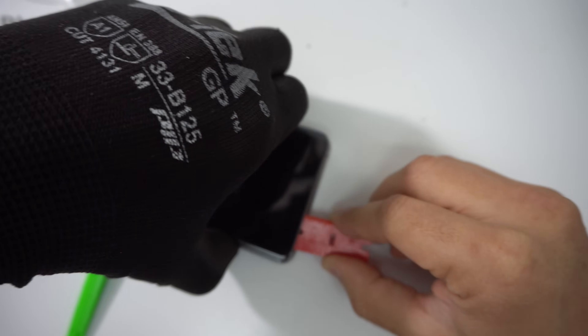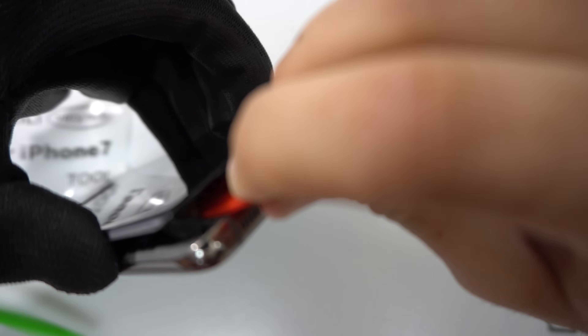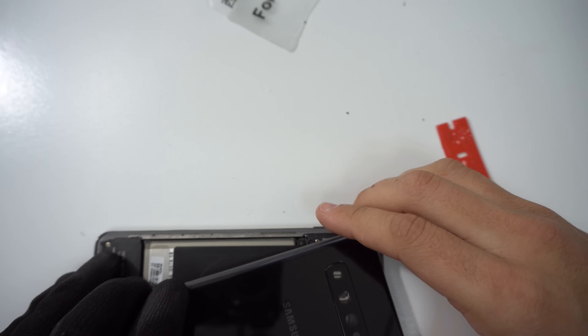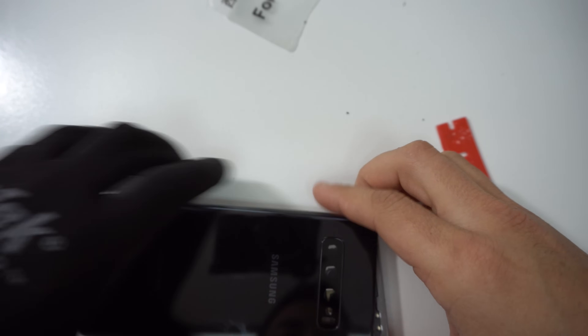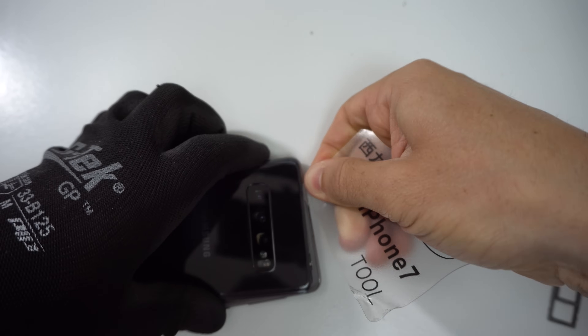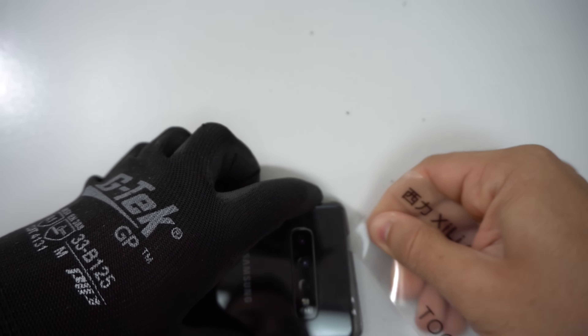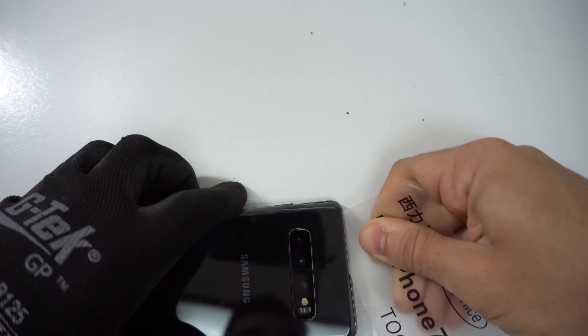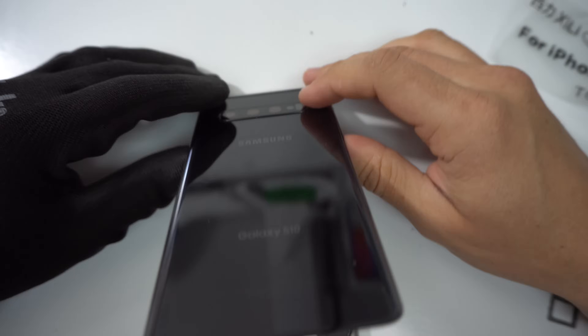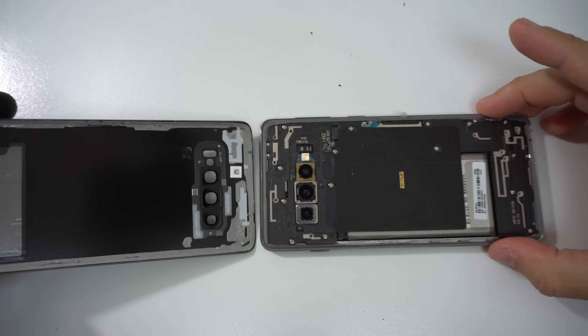Go ahead and lift up from the bottom of the back glass and finish releasing any leftover adhesive that might still be holding the back cover onto the frame. You might see some pieces of adhesive that are still stuck, so go in there and individually separate the pieces that are still holding it together. Once most of the adhesive is removed, wiggle the back cover from side to side. There may still be some adhesive in the top corners — use the plastic card to wedge in there and move it around until the adhesive is completely released.